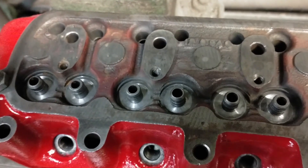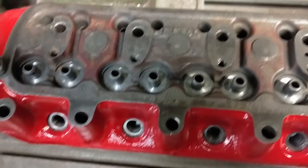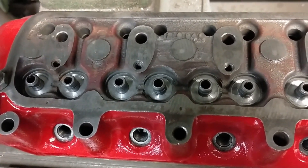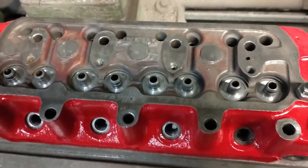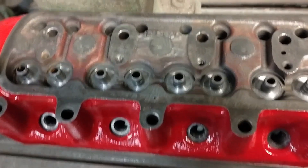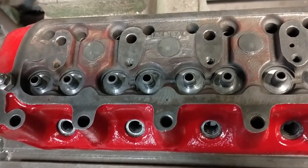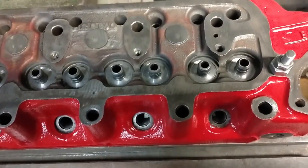This head was actually rebuilt some years ago and it's done very little since it was rebuilt. I'm hoping when I drop all the valves in that they're all going to sit the same distance from the face of the head all the way through. Hopefully it won't have to go back to the machine shop to adjust the valve seat depths, because you really want your valves all the same height and all your springs sitting the same height in the head. If you can get that right you'll get a more even running engine. Have a look at some of the MED videos on YouTube — they'll explain in more detail why you need to do this.